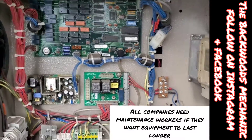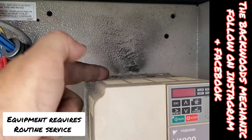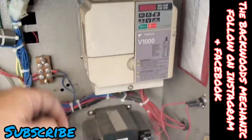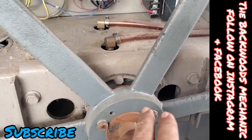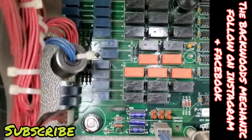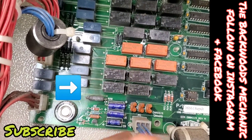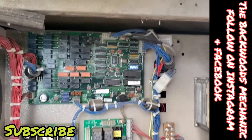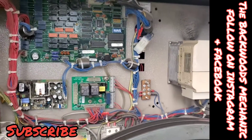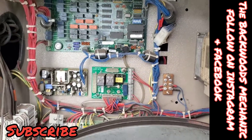Things like this have to be cleaned out periodically and took care of — if not, your machine's going to burn up. There's a little fan inside there that's supposed to be serviced on a routine maintenance schedule. If you don't have a routine maintenance schedule, you're just shooting yourself in the foot. These bearings take oil — you're supposed to add oil to them every so often. You can tell on this board right here there's been some issues — you see little black spots where something got hot. If they would clean this out every so often, once a year, once every six months, have a maintenance guy come in and take care of your washers, dryers, and other machines — take care of your equipment and it'll last longer.